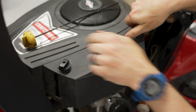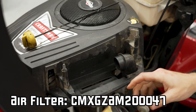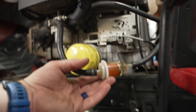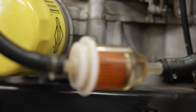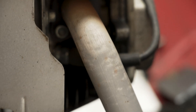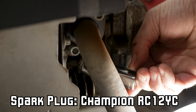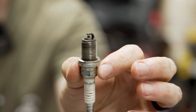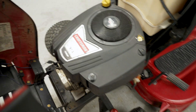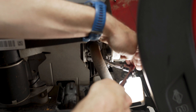The air and fuel filters are really easy to check or replace on this engine. The air filter is located under a cover held on by two thumb screws and was very clean. The fuel filter is an inline universal filter that you can find at any auto parts or hardware store. Let's check the spark plug — it's located on the front of the engine behind the exhaust. Remove it with a 16 millimeter deep socket and be careful not to burn your fingers on the exhaust if it's hot. The spark plug was in good shape, but a little oily, which could mean future engine issues are on the way. I adjusted the gap to .030 of an inch, applied some anti-seize, and reinstalled.